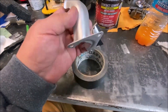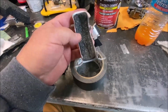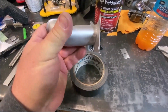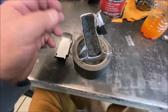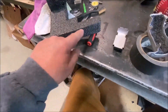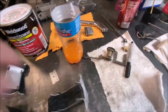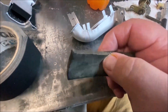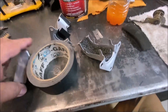This is the wiring loom guard that bolts to the front of the door in the jam, where the wires go from the body of the car into the door. This is foam I used from a carburetor box or something — I just trimmed it and glued it in there. The original ones are missing. Here's one original — it's a foam, hard like a rock now. This stuff is perfect, it's soft and pliable. I glued it in and glass beaded these and painted them.